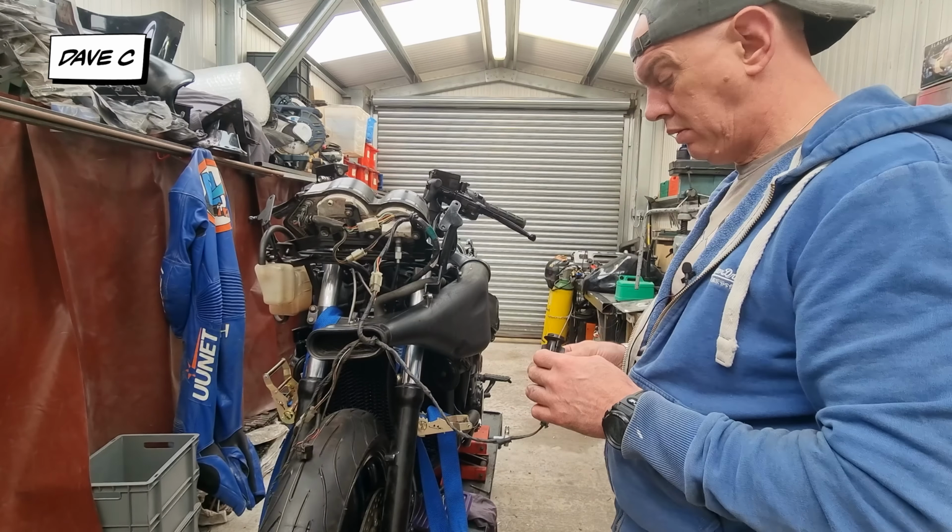Changed my mind. I was doing it wet, when the main reason was to keep the dust down, and that does keep the dust down, absolutely. The only trouble is you end up with a stripe of just sludge across here. You end up soaking wet, and you also can't see where you've been, what sort of finish you've got. I'm halfway through this at the minute, but you can see across here, from the cloudy nature of it, there are no bits that have been missed. Whereas here, where I haven't been yet, you can see it's all shiny.